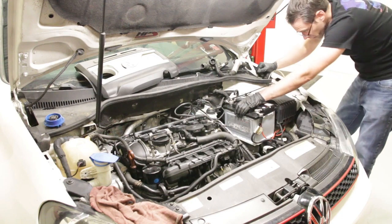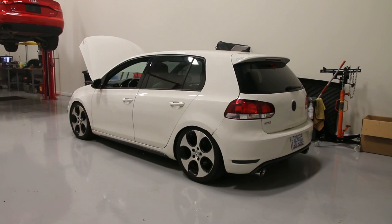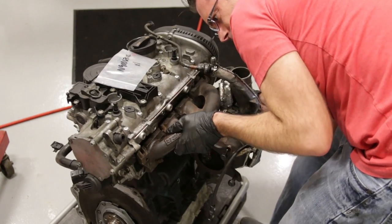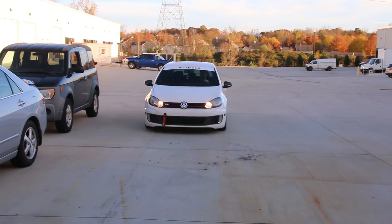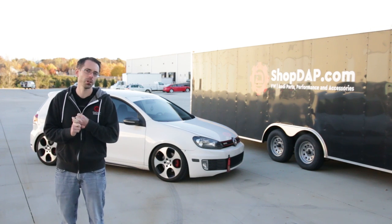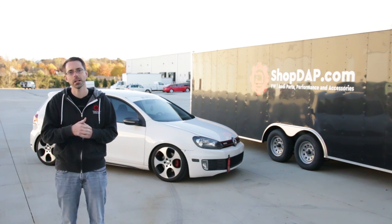After we cranked with no start, we determined that the vehicle had a bad fuel pump. We swapped out to a new fuel pump and test drove the vehicle. During the test drive we noted a misfire in the engine — unfortunately we did not replace the injectors, and the injectors and turbo were probably the only two things on this engine that were not new. We ended up having bad injectors, but were fortunately able to get that covered on the warranty extension for this vehicle. The car went to the local dealer and got the injectors replaced under warranty. We still have a few small details to address — the ABS module and a mass airflow sensor fault — but the major part of this build is done. We have completed our build on our Mk6 engine. Thank you so much for watching — if you like this video be sure to give a thumbs up and subscribe for more.